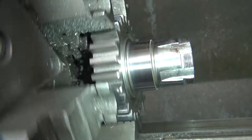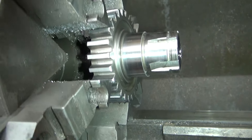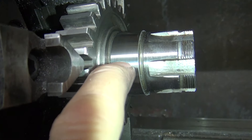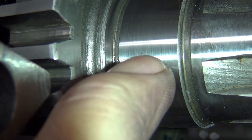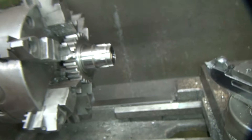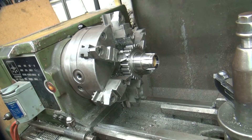You can see how it's nice and fairly even-looking as it goes around. I'm not seeing those high spots anymore. I'm sure the low spots are still there though — right there you can see a low spot, right above my fingernail. All right, so we're going to clean this back up, put it back in the transmission, and see if the noise has gone away.